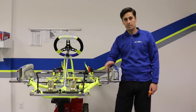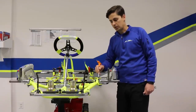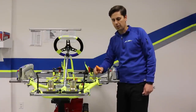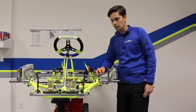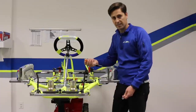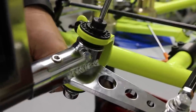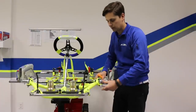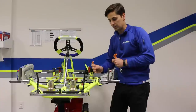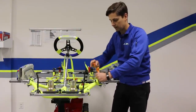I'm going to show you how to make the adjustment. You make it by rotating your eccentric washer, which all chassis have, inward or outward. Some chassis have a different setup, but this is predominantly the system used on all chassis. To do that, we need to loosen the stub bolt — on the CompCard that's a 5mm Allen and a 13mm wrench. We'll loosen this bolt, no need to take it all the way out, just enough so you have a little bit of play. Now we need to loosen the grub screw that holds the eccentric in place — that's a 3mm Allen on the CompCard.